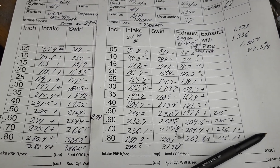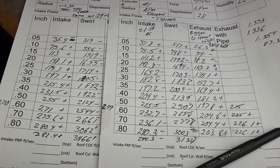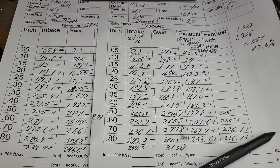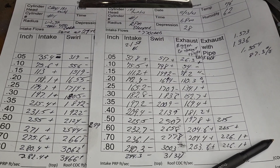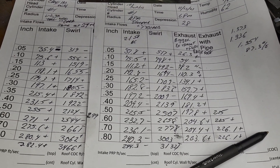That flow would go up if I put a bigger carb on it — I'm not planning on using just a 770. I run a 900 CFM fuel injection on the old work truck 355, and with fuel injection you can get away with a bigger carb because it's not depending on the booster signal, it's squirting fuel right in.